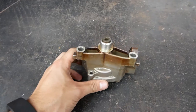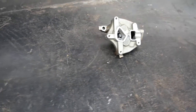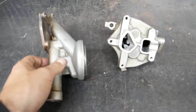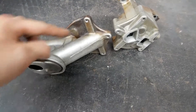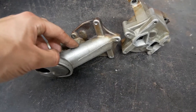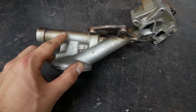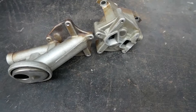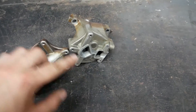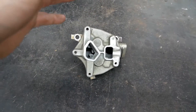So here we have the oil pump that I cut on one of the previous episodes. Normally instead of the hole here we have this part here — this is the same part that I actually cut. My first idea was to cut the pickup here and re-weld a new one. By doing that I also needed to remove the oil pressure regulator here because it interfered with the subframe, and I would have needed to reinstall a pressure regulator. Then I decided to ditch this part completely.